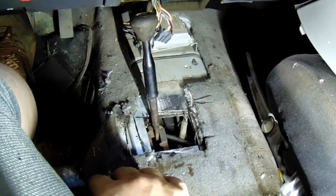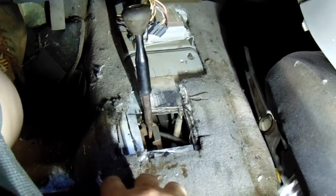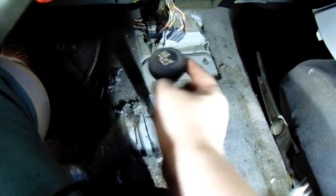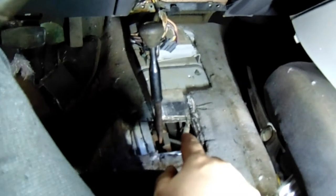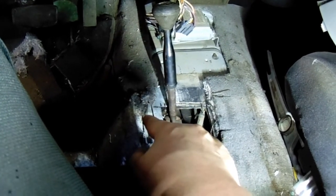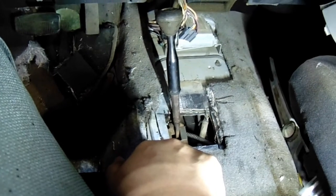Sitting in the car, it's running. This is the way it turned out — I cut the hole a little too big and a little too far that way, but what are you going to do? I got four high, neutral, and four low. She shifts good. The rubber bumper is a little soft — that spring back is okay, but if I had to do it again I'd get a bigger one. She goes through all the gears just fine. I do want to keep my center console, so I think what I'm going to do is cut the shifter off at the threads, weld on a plate of steel, move it over an inch, and maybe put it at an angle. I'll set the center console in and figure it out.